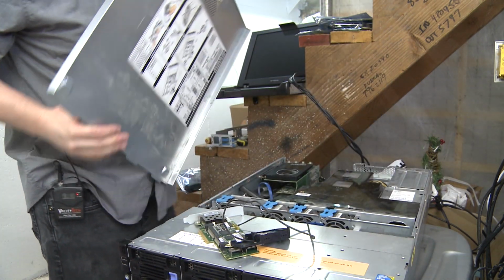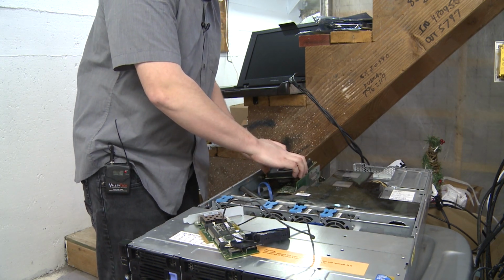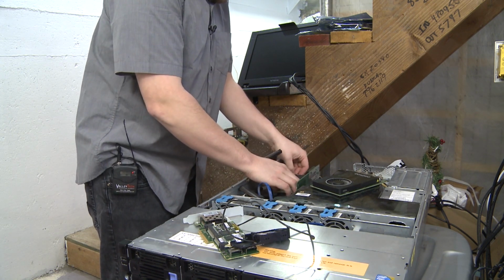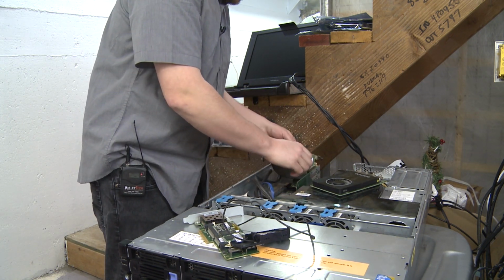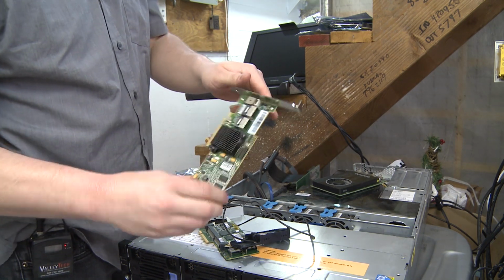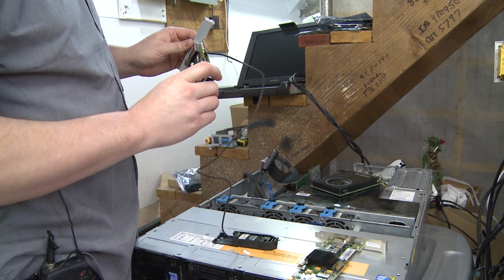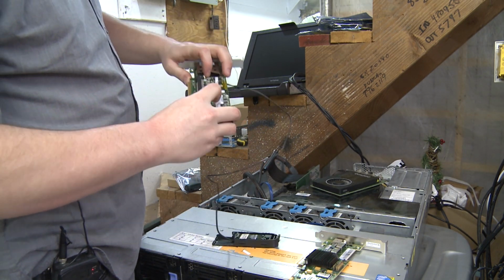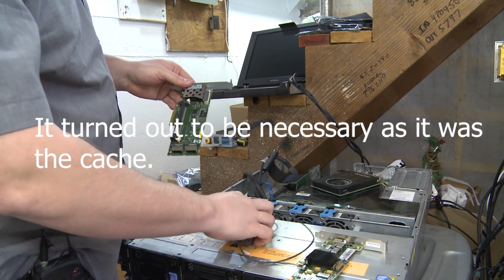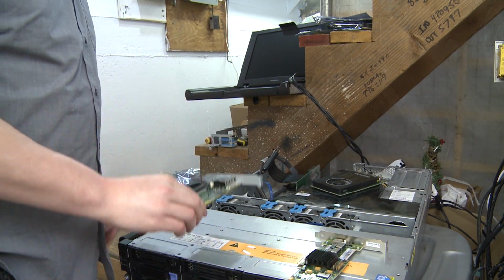And we're just gonna pop this sucker open again and switch out the RAID card. So, Quadro, out you come again. And now the ribbon's in the way, kind of. And, oop, there we go. And here is our LSI card. And we're gonna take that out and replace it with, as I showed you, the HP card, which I actually have no idea if it works or not. And I'm actually gonna take the battery backup module off because it's literally not necessary at all for this purpose. So we're just gonna stick that guy out of the way. And we're gonna stick this in and see if it works.